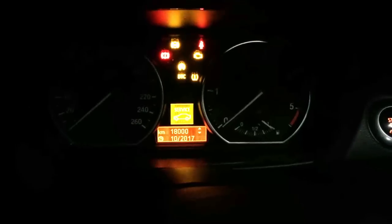Put your gearbox in neutral, engage your handbrake, and press start — but without pressing any pedals, because you don't want to start the engine yet. You just want the glow plugs to heat up. I'm doing this right now and my glow plugs are heating. Okay, that's done — turning it off.